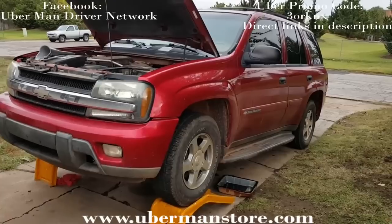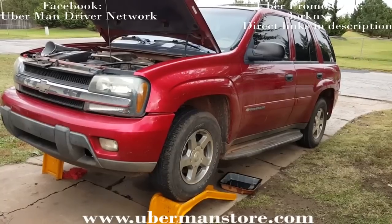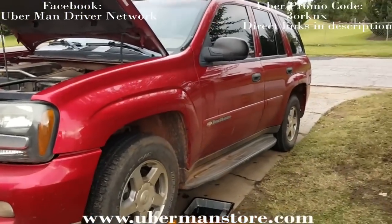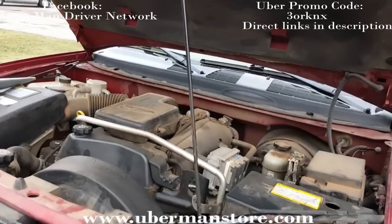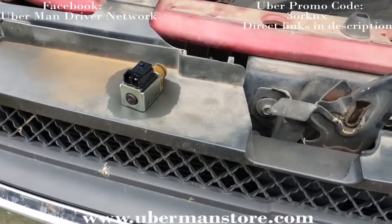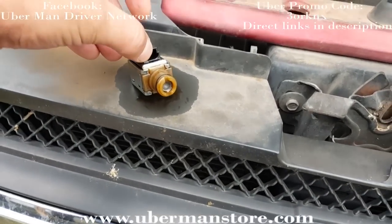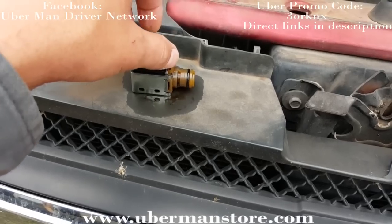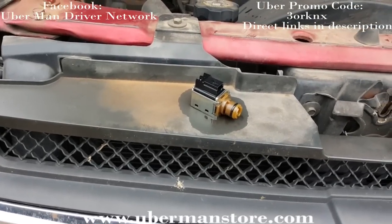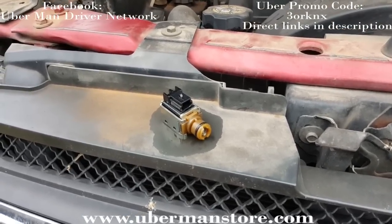What's going on YouTube, Uberman here. I picked up this 2003 Chevy Trailblazer, it's the 4.2 inline 6 with the two-wheel drive transmission. I picked it up for $700 — they were asking $1,100 but I talked them down. It's got about 160,000 miles on it, a little dirty, definitely needs some cleaning. I bought it because the seller was saying the transmission was going out. It was stuck in third gear — it'd go in reverse just fine, good power in reverse, but as soon as you put it in drive, no power at all. Very difficult to drive that way.